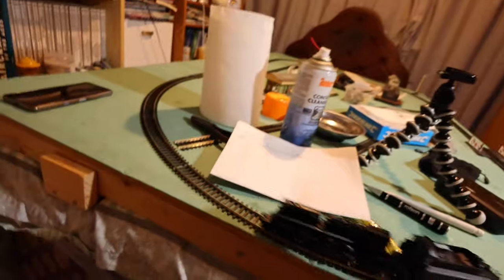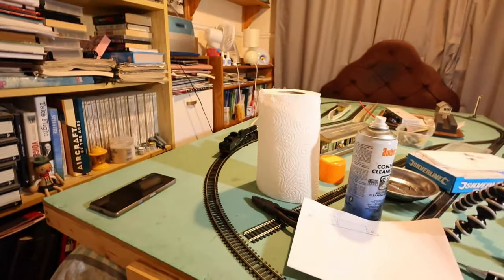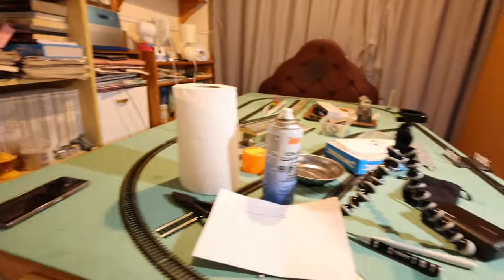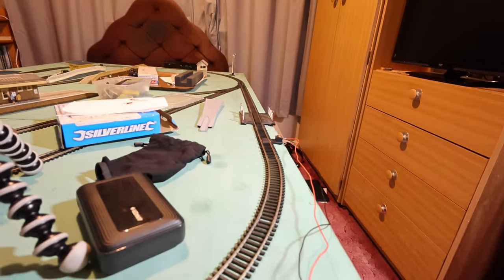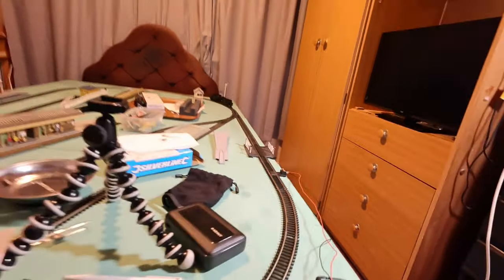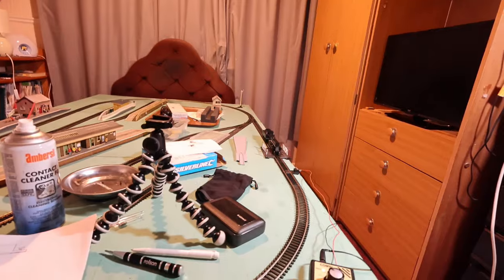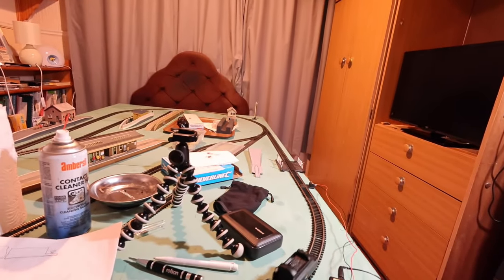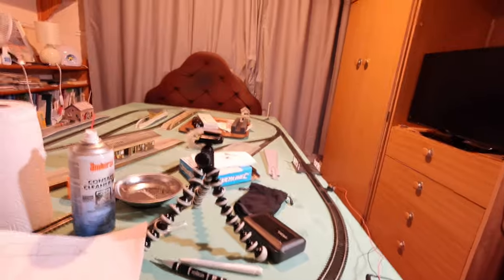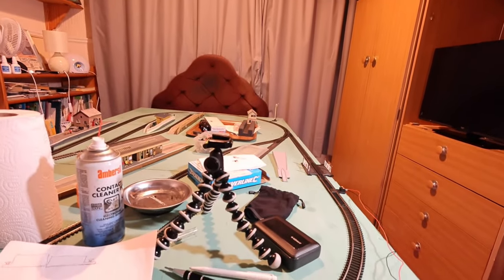I mean, you could either do that, or you could find some way of putting some kind of different thickness of packing pieces underneath the actual motor cover. But I've just actually adjusted this now. My guess is that if anybody ever takes off this motor cover, which not many people would find cause to do so, if you do that screw up too tight, it's going to press that motor cover down too far and bend that bracket back up again.